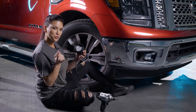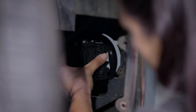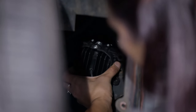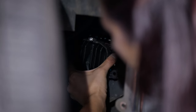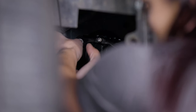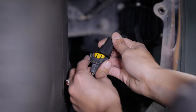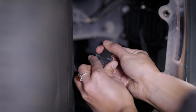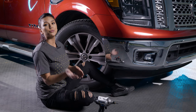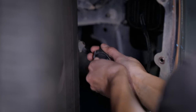Now that your old fog light is out, it's time to put your four banger in. It's a pretty easy install — you just have to finagle it a little. Usually put one side of the fog light in first, then place it in and line up that screw area, and your four banger will slide in just like that. Once it's in place, screw it back in with the OEM hardware and tighten everything down. Plug your harness into the OEM harness. Before you put the paneling back on, make sure to test your four banger first. If it doesn't work, you may have to go back to the harness, flip the cable over, and re-plug it in.